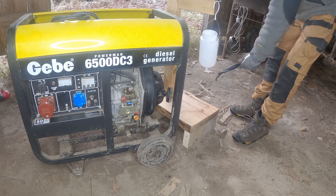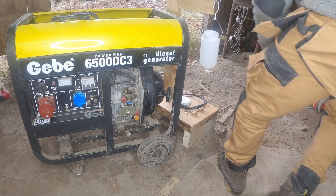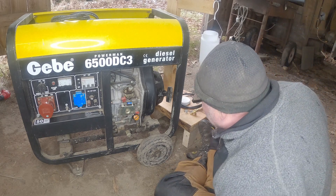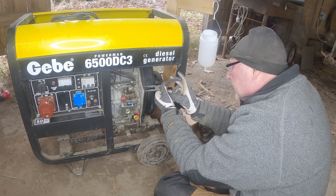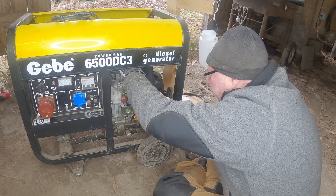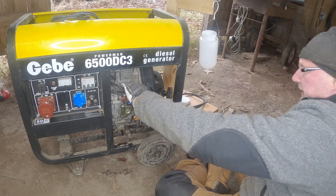I have made a small rack to hang the fuel tank from so that it won't shake too badly. I start by removing the fuel hose from the tank down to the diesel pump — it's held only by a clip so it's easy to remove.